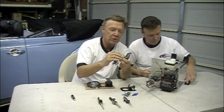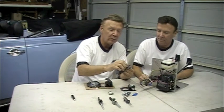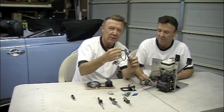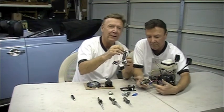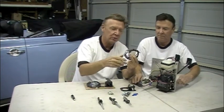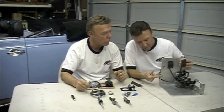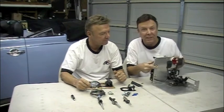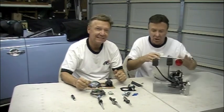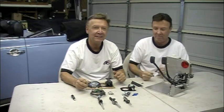We talked about the switch in the back — we want you to leave those wires intact, because that is your factory unit. With the wiring harness, we've made it so all you have to do is tie into that system. Now you're going to have the original switch and the smart brake light system. The wiring harness is long enough to connect to the terminals up inside the trunk area. We have the smart brake light system on here — now we're going to put the original system on and you'll see it all works in conjunction together. On this system you have two switches: the hydraulic and also the electric.